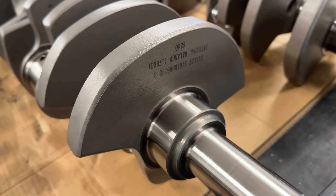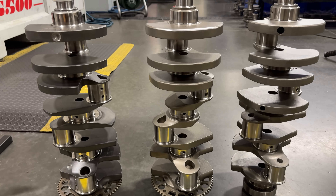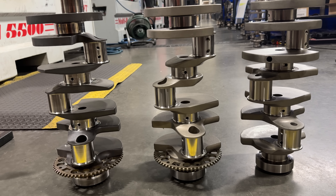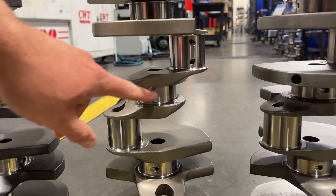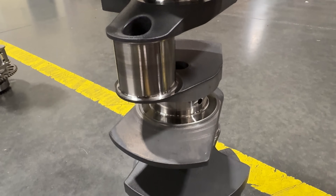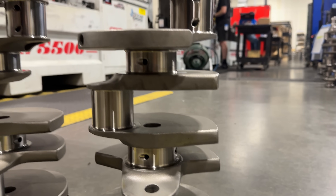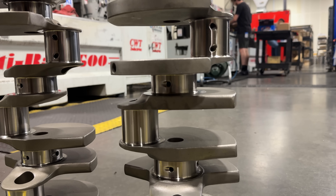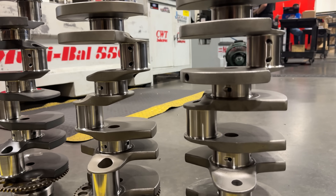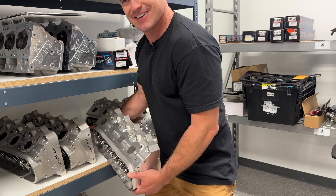I busted out a few crankshafts so we can compare and contrast. On the left we've got the Apex from CompStar, in the middle we've got the Texas Speed counterweighted crank, and on the right we've got the big Dart. You can see the difference — the Texas Speed one does not have the big center weights. On the CompStar, the center weights are beveled. On the Dart, they're nice and thick with no cutting, because the block is already clearanced for it. If you tried to run this Dart crank in an LSX block, you'd 100% have to cut it down.